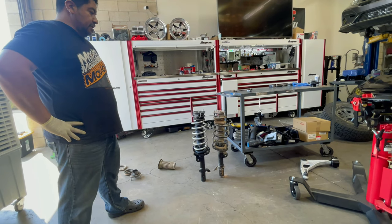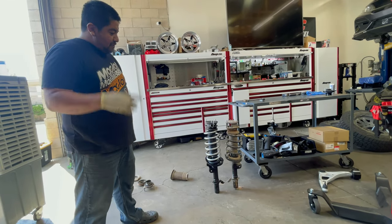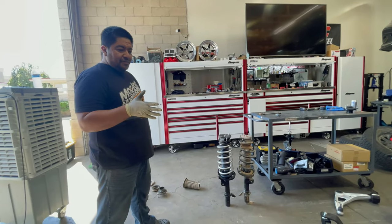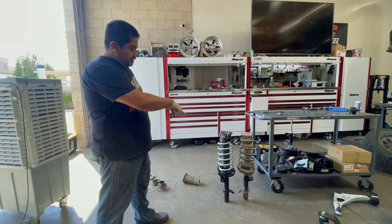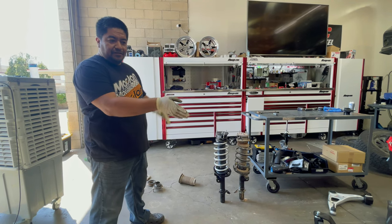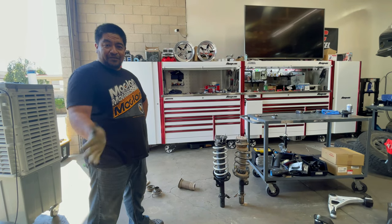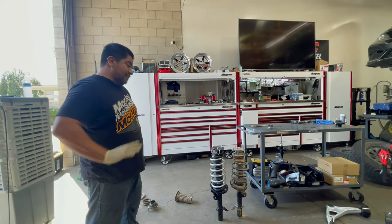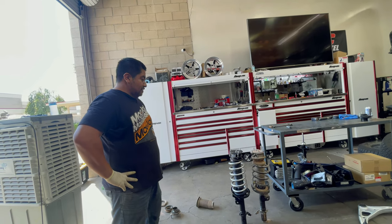That's a preload spacer, right? Right. Okay. Which now has my gears turning in my head. What if, as a freebie mod, someone used the Ridgeline spring on a completely stock Passport strut with the strut extender, since that spring's longer? Kind of like an even more affordable option. Right, right. I mean, I don't know what the exact height would be, but that would definitely be interesting. Good stuff.